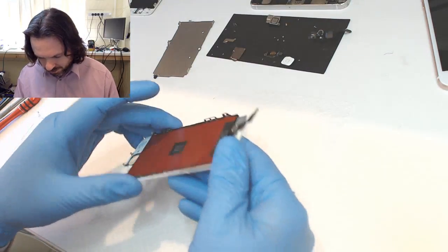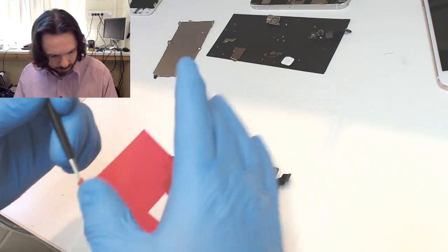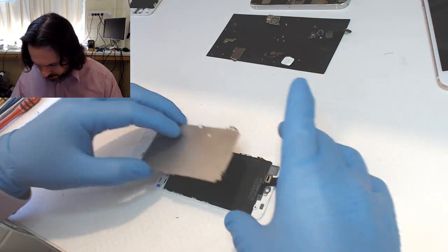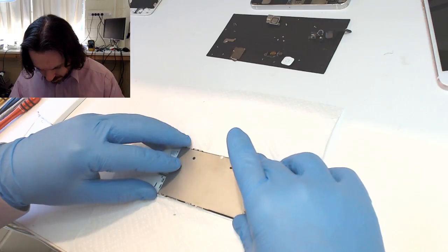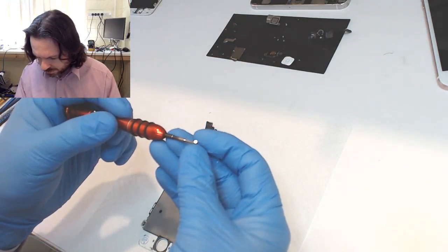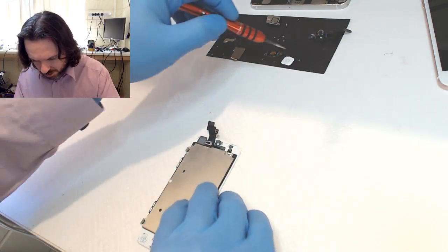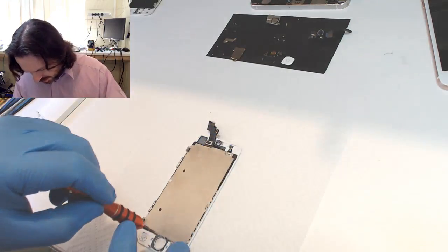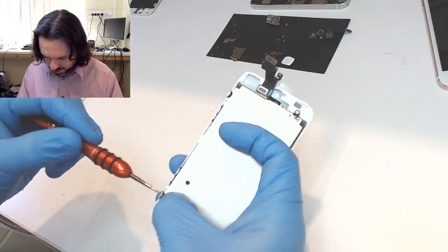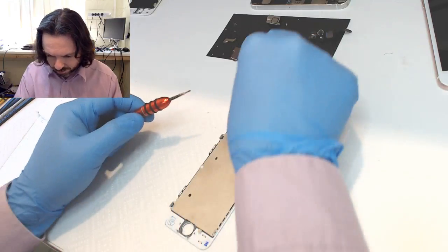Oh, hi Austin. Yes, very, very happy I've got that microscope. I've already done a couple of commercial jobs for it, as in paid jobs. One was a MacBook Pro U8900 issue. The customer should get that back today and deliver that. Hopefully it all works. The big problem with the U8900 issue is that it's intermittent, and when I received the machine here, it was behaving perfectly fine. So I repaired, or did the resoldering of the U8900, tested it for several days, it seemed good, sent it back, but that's no guarantee.